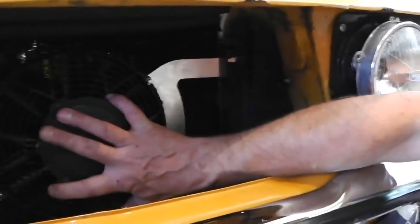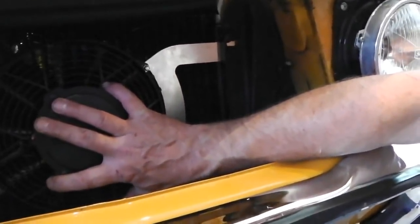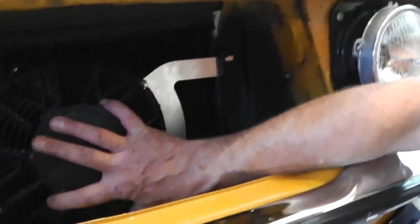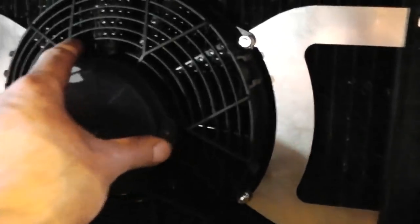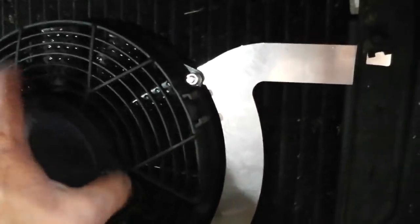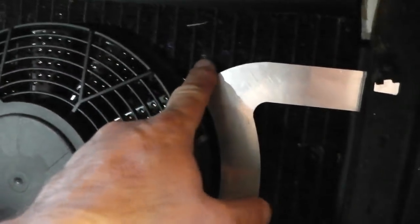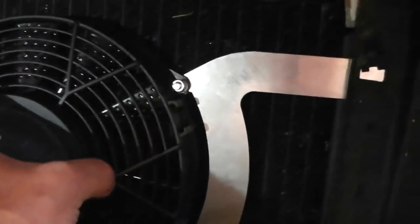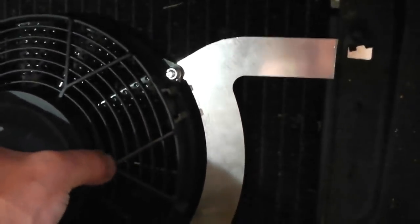Okay, so I'll obviously need other hands now. I'll tighten up. We should be locked up. And we'll check the clearance on those bolt heads against the cooling fins and the cooling. Okay, we're in nicely centralised and no touching on there. And you'll see them bolts are in line with the cooling fins themselves, not the core. So if they ever did slam into the rad, they're not going to hit the waterways.